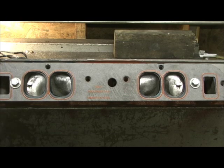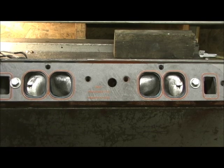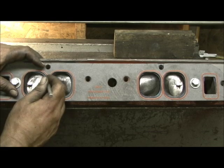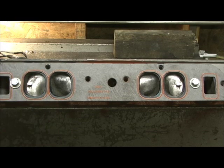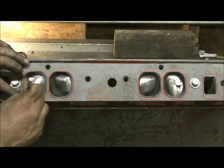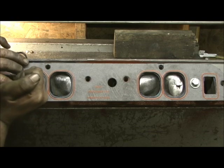The customer who owns these heads serves for our country — he's in Afghanistan. He had these heads, and apparently before he'd gotten a hold of them, somebody tried to go in there and play cylinder head porter. When they did, they took so much meat out. As you can see, like the TBI heads and a couple others I've showed you, I've got plenty of meat here and on the bottom, but somebody went in there and butchered it. This gasket has just barely, by the skin of its teeth, given me enough room to go in there and straighten this mess out — it took the biggest oval gasket there was to do it.